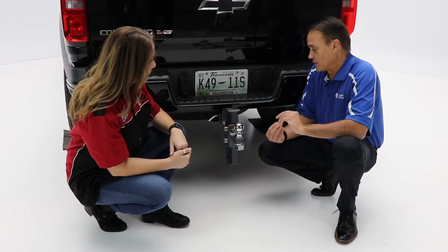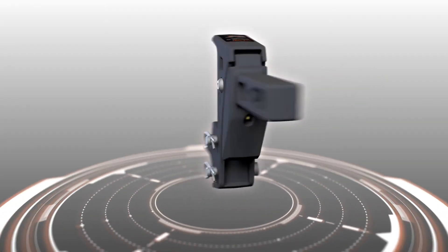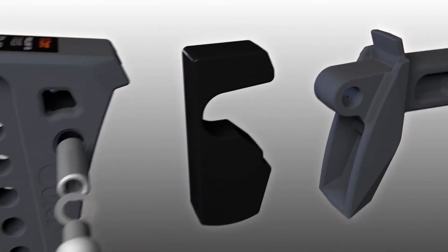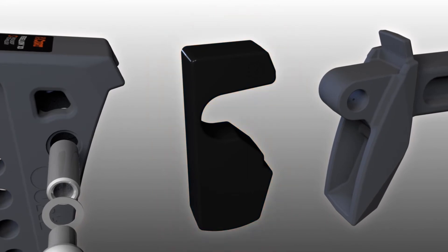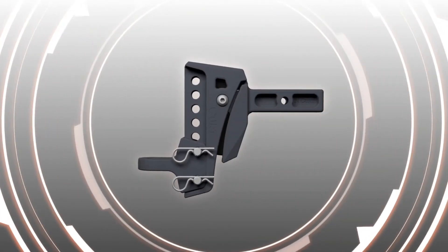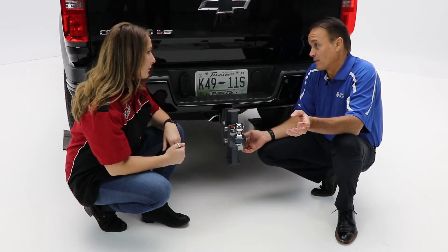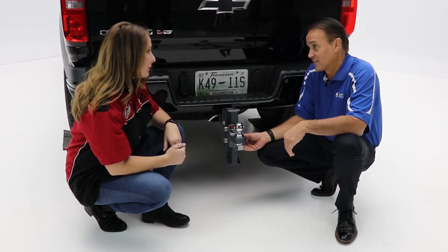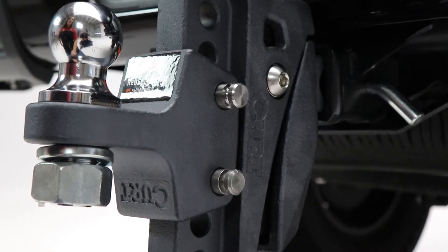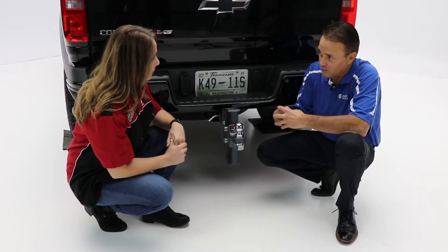What's unique about this is that it has a cushioned isolator made from polyurethane, and it absorbs the vibration — actually dampens it — all while protecting the towing vehicle's suspension and brakes. In addition, it has no bearings or any type of airbags that you have to maintain over time. So basically it's maintenance-free. It's just a really good system that absorbs the jarring and compound stress that a trailer takes over time.